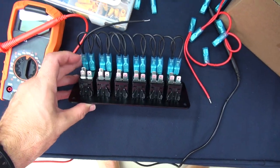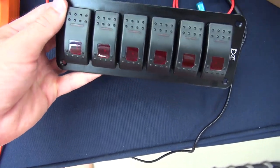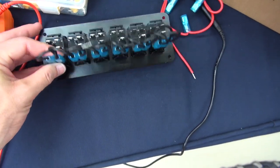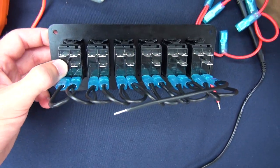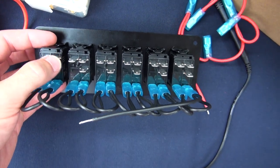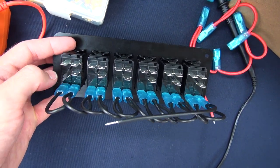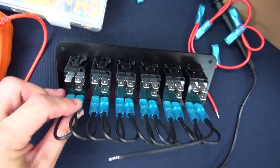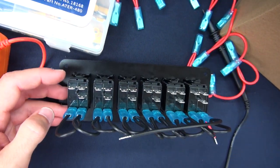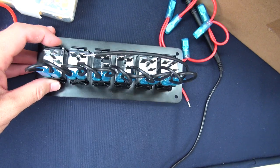After messing around with the rocker panel a bit, I think I figured out why the wiring looked so strange originally. If you look at the switch, this is off, this is on, so it goes this way: off, on. On the back there's a ton of connections, which I was kind of confused by at first. I think these two have confirmed close when you turn on the switch, so these are where you would connect the power source and your load. Then what I'm assuming is that the one directly below it is the negative for that load, and on the left you have your positive and your negative for the lighting of the switch.